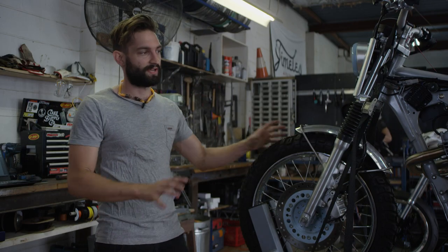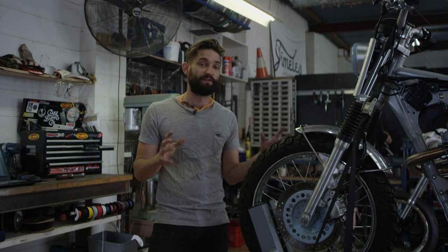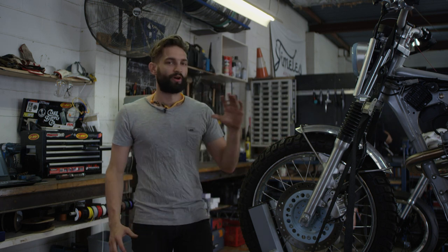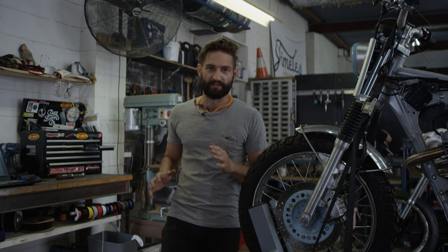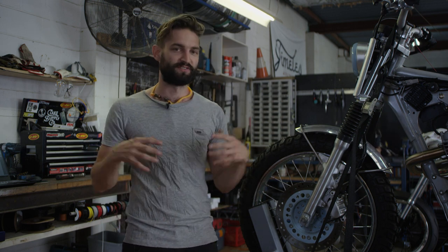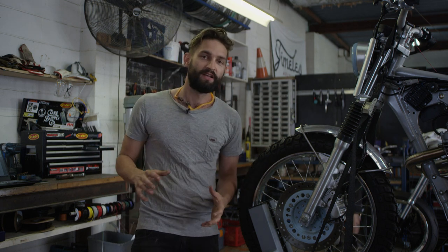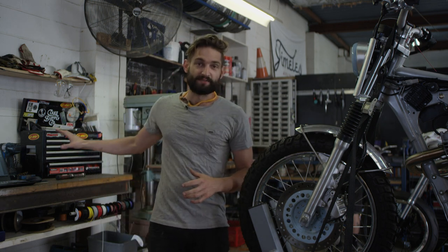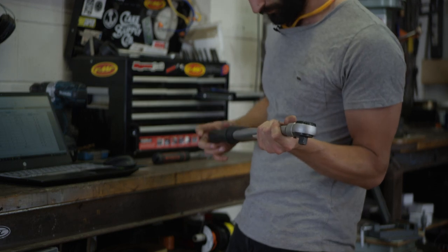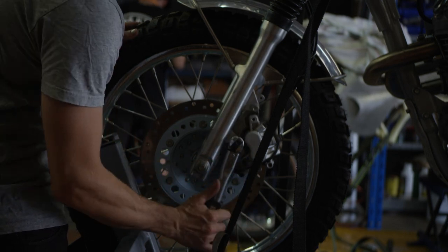Now that we've buttoned up the electrics, I've taken time to put the chain on. We basically have a finished rolling motorcycle. I run through end to end on the bike and torque absolutely everything. There is a massive human element in what we do with the creation and design of these things, but when it comes to torquing, I don't trust my hand and eye. To take out human error, I always set up my laptop with the workshop manual — it'll have a torque table so every nut and bolt gets its torque setting done up before it goes out on the road.